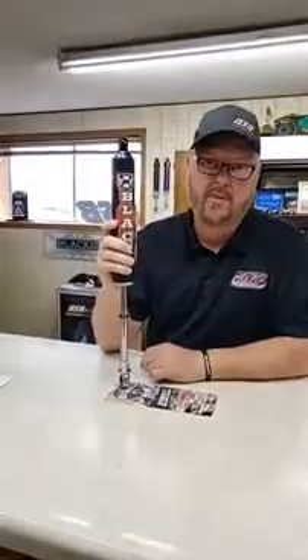Here's why owning a spec shock is going to cost you money — and it's not a UMP deal, it's not an IMCA deal, it's not a sanctioning body deal. Basically how it works for us: you call here, we go through your car, we valve the shock. The customer calls, gets his four, five, or six shocks, goes out and starts winning races. If he has problems, he calls us back, we go through the car. Nine times out of ten, we fix the car, not the shock. Once we get the car leveled out, we may have to increase the valving to make it better, and that costs like $35.